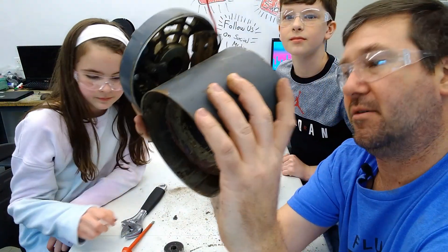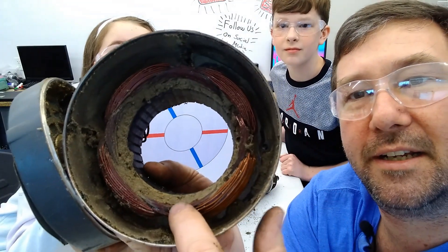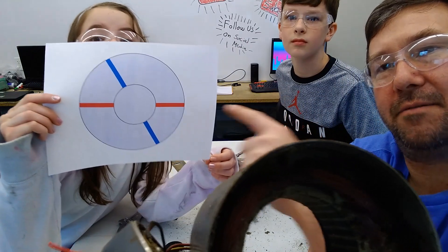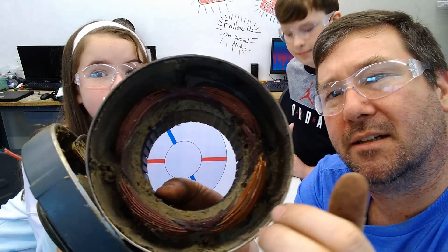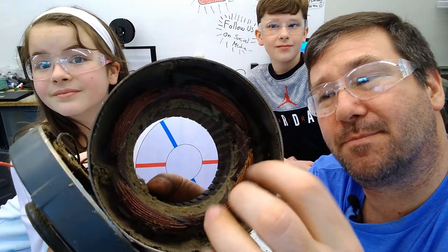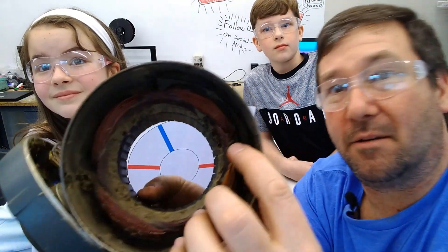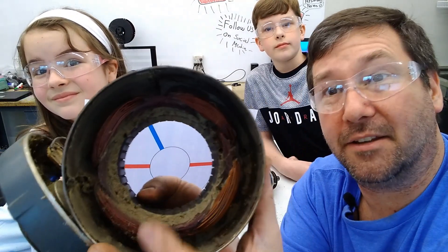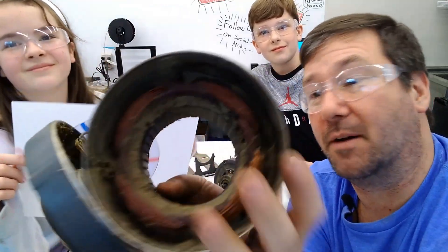Wendell, grab that picture right there. And if you look closely — and hopefully this shows up in the video — there is a really big winding and then there's a smaller winding, which is kind of the two windings you see here. And I get the feeling the bigger winding is probably — and here I'm probably going to use the wrong term because this is more of an exploratory video — but I'd say it's creating a greater inductance that kind of causes that phase shift that'll make the motor rotate. So that's kind of my crazy thought on how this motor actually works. And somebody who's super smart will be sure to correct me in the comments if I'm wrong.